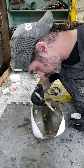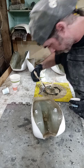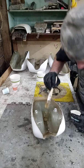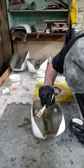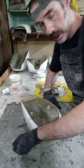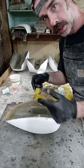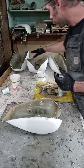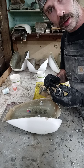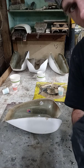I haven't seen any videos doing this online, so if you guys are looking to take some of my business or compete with me, I'm showing you right now. So that's pretty much it — gas tank lamination, putting the halves together, laminating, caulking the outside edge, laminating in there, letting it dry, and then I actually come through with a wet brush so we don't have any dry mat, and it has a little more aesthetic appeal. Put your hands under there and you won't get hit by any stray fibers. Guys, let's make dirt track great again!